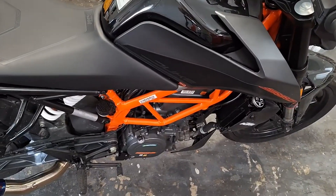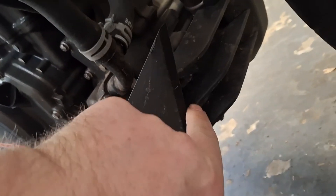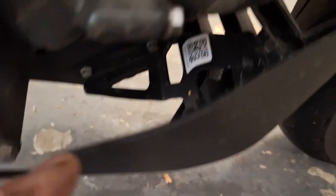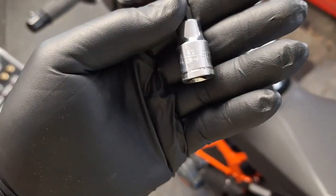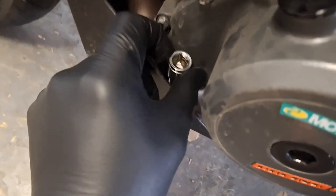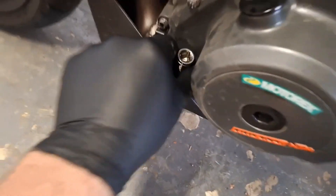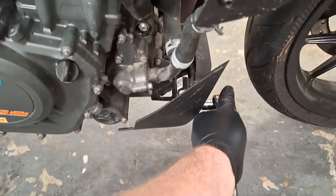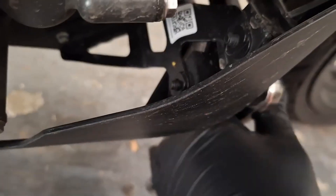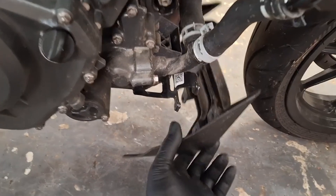On the right side of the bike, there are two screws right inside of here. Here's the other end of the screws — one here and the other. Get your Allen wrench right in there. That should be all the screws and this should slide right off. It's a four millimeter Allen. Working the first Allen head screw out — broke it loose with the three-eighths ratchet and taking it the rest of the way out, on the left side of the bike. Getting the last two screws off, this came right off.